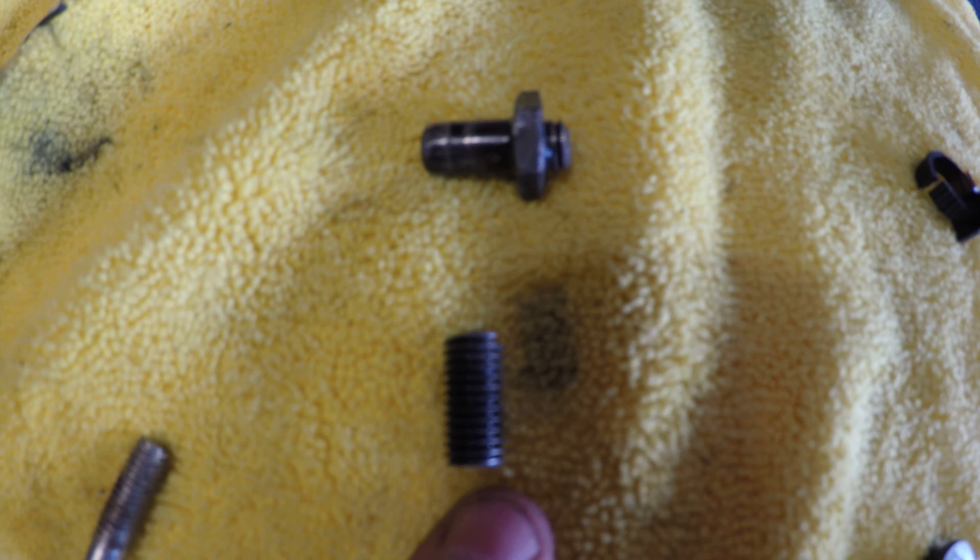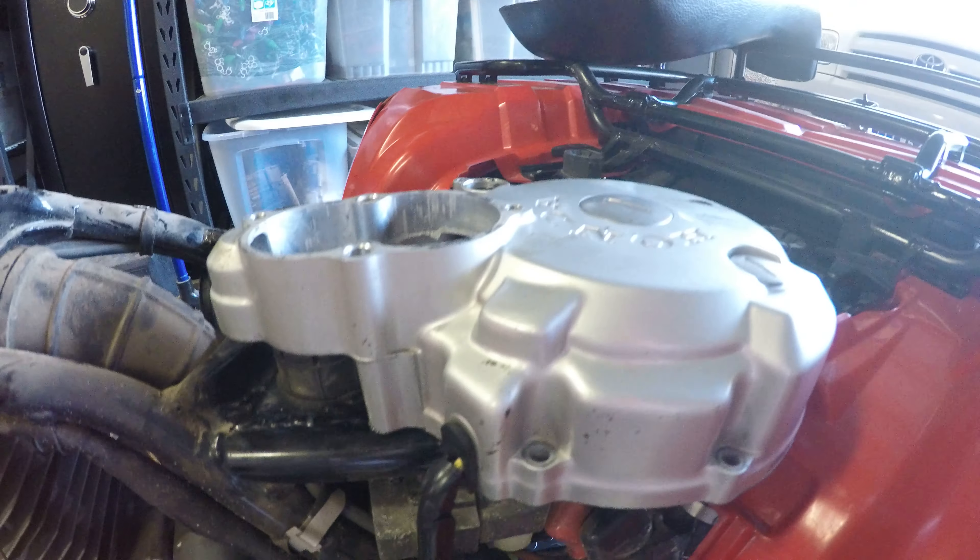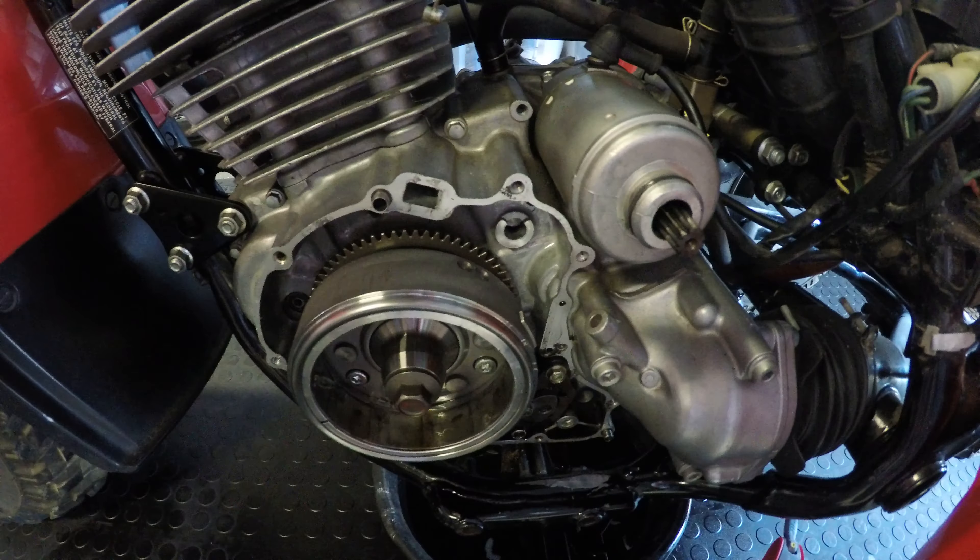For this job I had to order quite a few parts. I ordered the starter cover here — I think this is called the starter reduction gear gasket. My gasket looks pretty good but I'm going to replace it anyway since I'm in there. This is the shifter seal, got a little messed up pulling it out, so I ordered one of those. I also ordered a new gasket that goes around here to seal it, and a new O-ring for the starter. That should keep this whole case all secure and sealed.